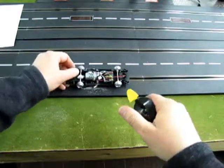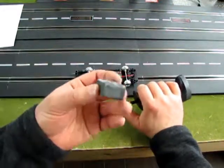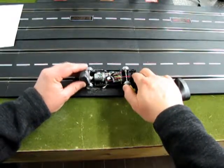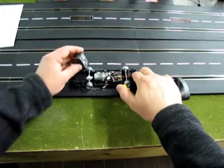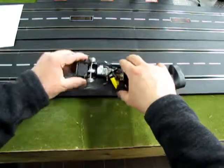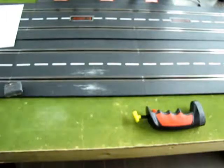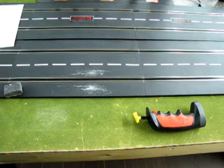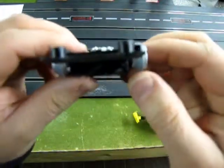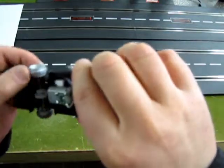Now what you can do, because 180 grit leaves some sand scratches in there, so if you want, this is a block with a lighter grade sandpaper. And actually, there. Now that'll smooth out some of those sand scratches. But the thing is, the sand scratches don't really matter, because as long as this area at the top of the wheels is flat, where my fingers are rubbing, your tire will seat 100% perfectly there.